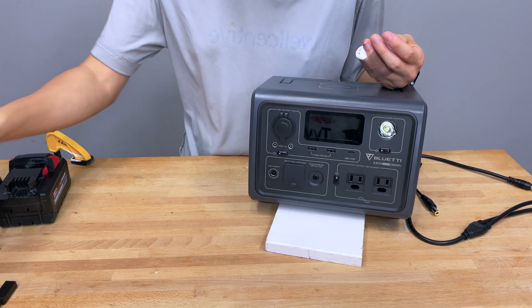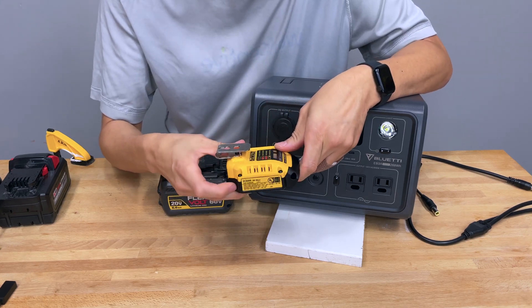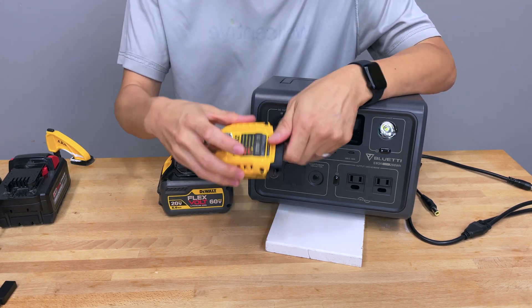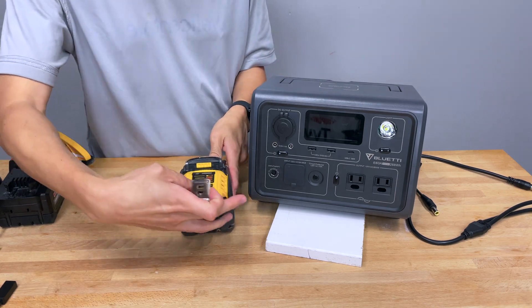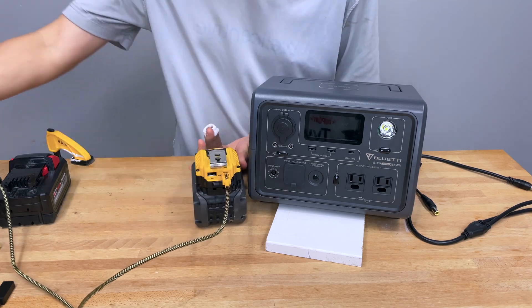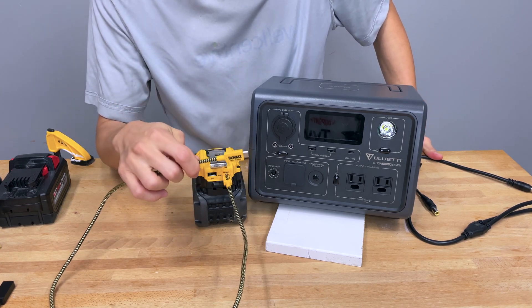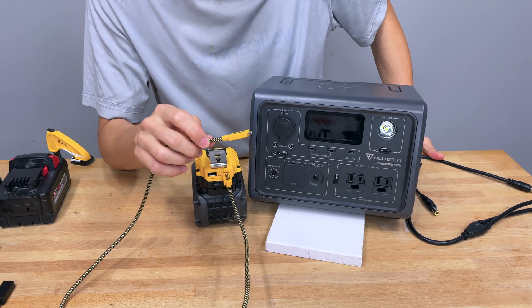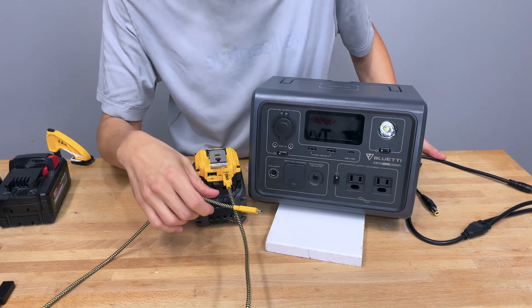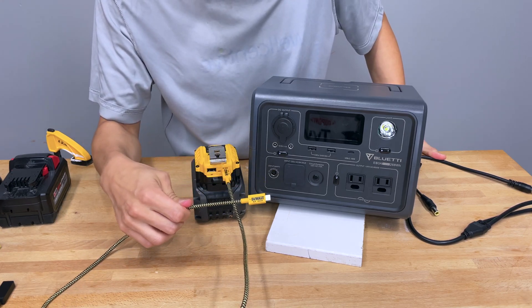Let's start with the DeWalt dual FlexVolt battery - we'll come back around to it. This is the DCB094K. The good thing about this is it has 100 watt USB-C power delivery capability. Definitely watch the video we have on this unit directly if you haven't. This one can do 100 watt power delivery and comes with a 100 watt power delivery cable. Keep in mind not all USB-C cables can do power delivery, not all are Thunderbolt cables, and not all USB-C power delivery cables can do 100 watts - most will probably be around 65 to 45 watts.